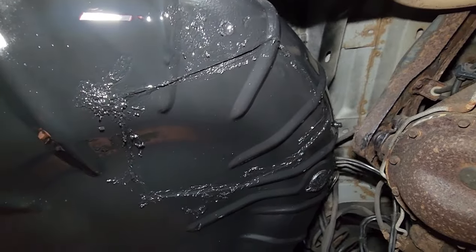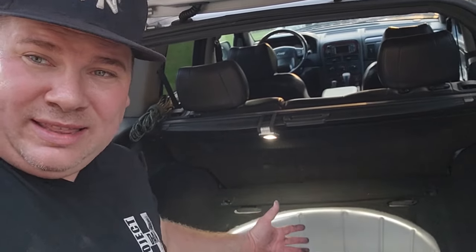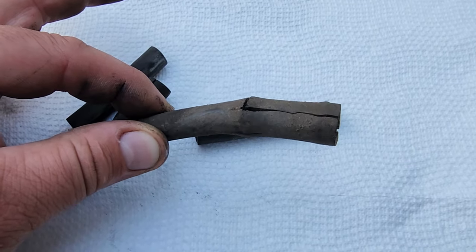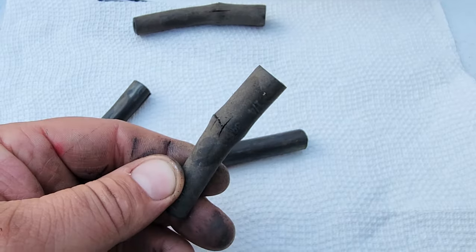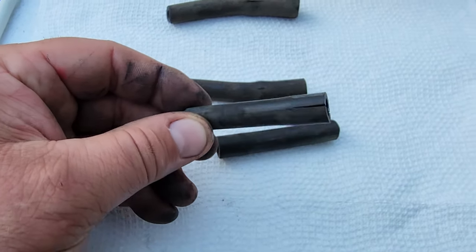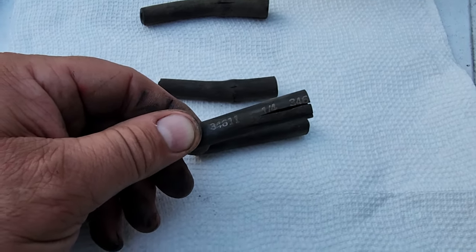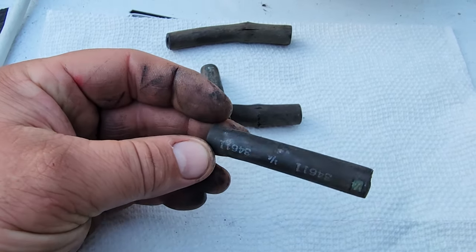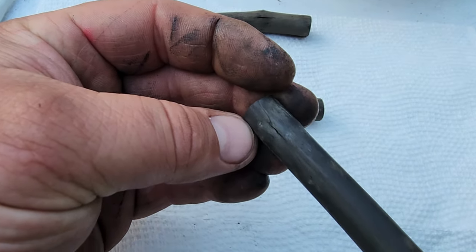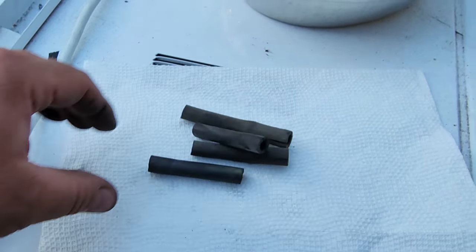Don't cut into your floor without the fuel tank already down — you could cut into the tank and the sparks could ignite vapors with evap. Let me show you right here, guys. Look at how rotten the ends of these evap lines were — all of them. They're all split badly, so I had a lot of fuel vapors. You don't want to start sending sparks out right where these things are leaking. Even the ones that look okay still have splits in them — rotting everywhere. I cut off the ends and mated them up with a little barb fitting, and it's good to go now.